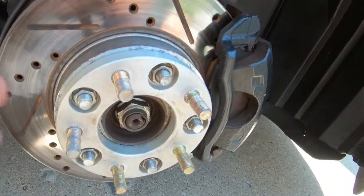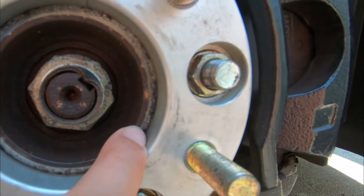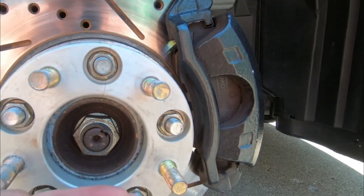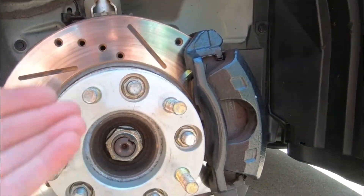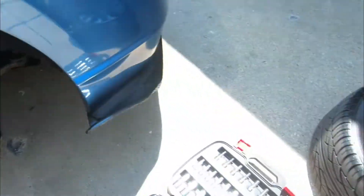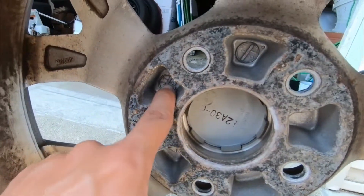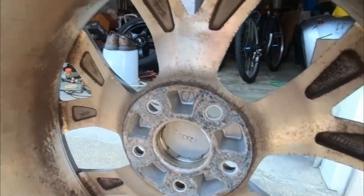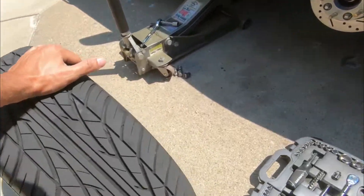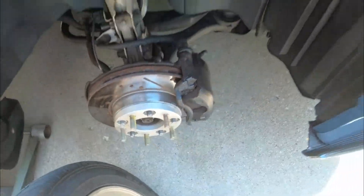For demonstration purposes this is fine, but if you were really running it you'd want the hub centric ring adapter. You can see the factory hub is way smaller than the bore in this spacer, so the wheel won't sit perfectly centered without that ring. Make sure when you buy these things they're hub centric spacers. Also, the factory studs are still sticking out — in our situation that won't be a problem because these wheels have engraved slots. If your wheels were flat surfaces, you'd have to grind the factory studs down at least half an inch to get the wheel on.